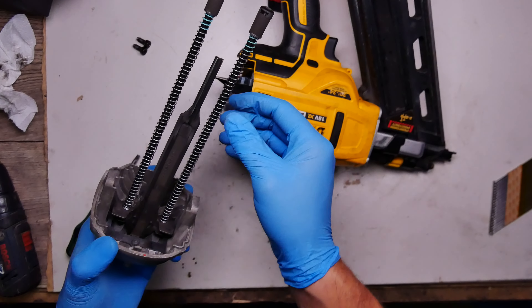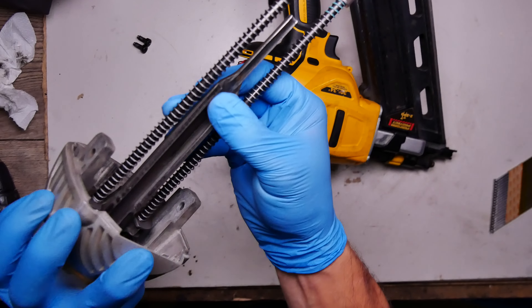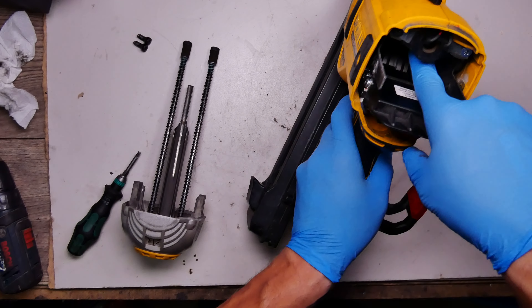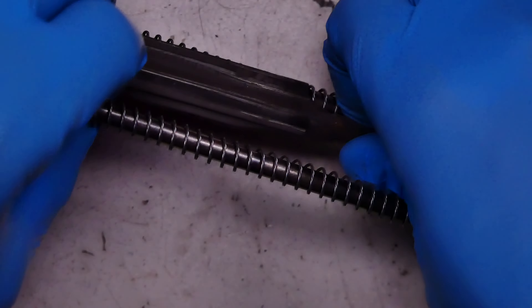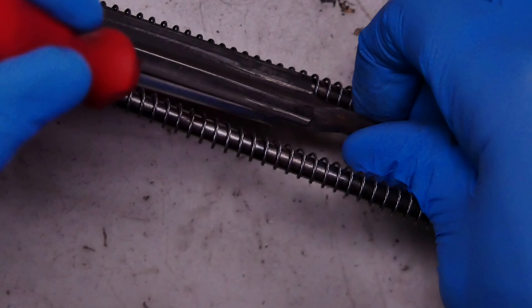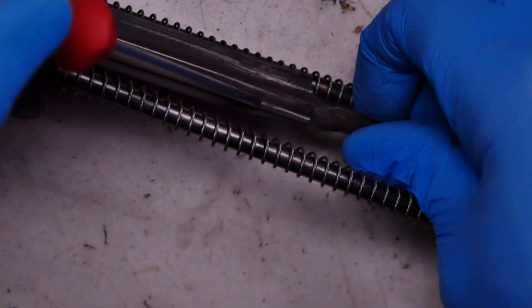Getting them out and searching for wear and tear signs like these ones. Now I need to check the drum very closely — try to focus so you can see the mark here. This is the mark of the wear and tear, and that means the striker is worn out.